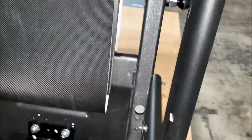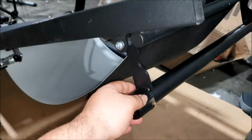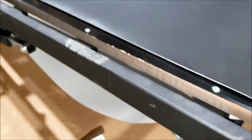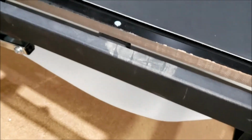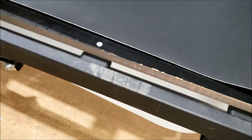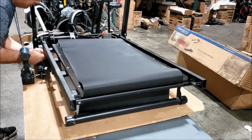And there's ones across the way on the right side also. Those need to be removed. On the opposite side, those are Phillips heads. So to get that job done, we're gonna lower the deck and we're gonna use this bar here to hold the deck up so that we can gain access to the nuts on the bottom. And the nuts are a 10 millimeter. So if you have a socket, you could put the socket on there and remove it with the drill up here. All right, with the deck lowered there, we're gonna get these bolts off.